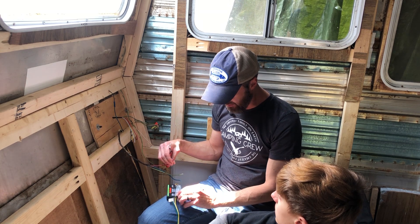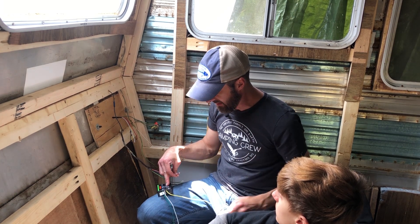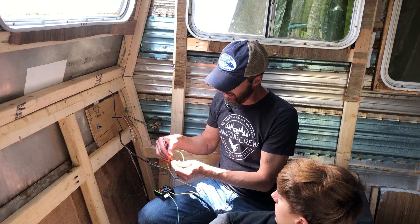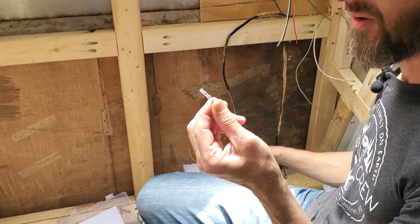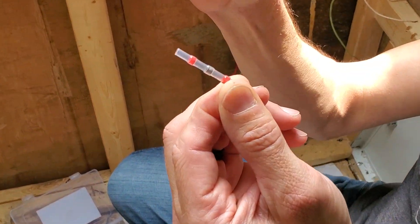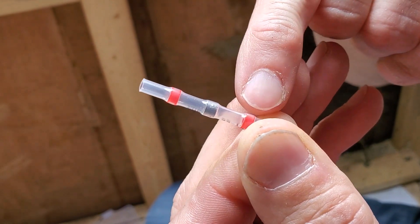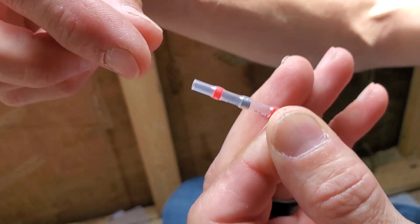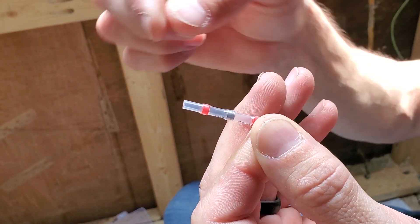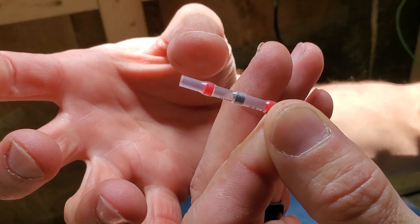On the input side here — we're on the left hand side of the vehicle — we're going to take this yellow wire, strip it back a little bit, and splice the two together. These are solder seal wire connections. There's a little solder joint right in the middle, and the rest of it is like a shrink tube. You insert each wire from each side, then use a heat gun to apply heat to the solder joint — that melts it and binds the two wires together.